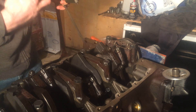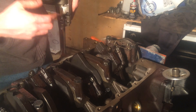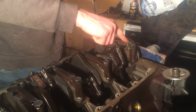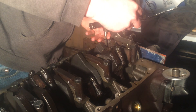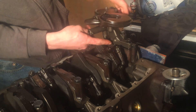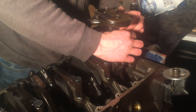There are two bolts — a short one and a long one. The long one goes in the back because there's more material. And there are two little dowel pins here so you can't really mess it up. But you definitely want to check the mating surface — the oil pump surface and the cap surface — and make sure they're flat and there are no burrs or anything.